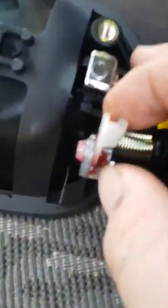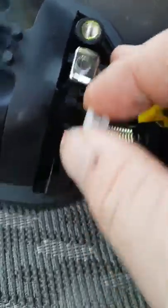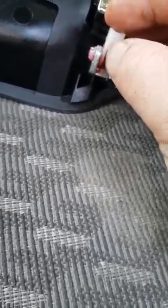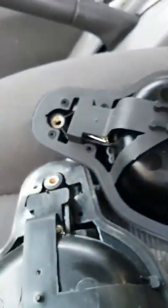Here's what I actually did - I took it out, put grease on it, and as I'm wriggling it back and forth I dropped some thin air tool oil on it as well. It still feels a bit tight but I'm sure that'll sort itself out eventually - it's certainly a lot better than what it was and it'll improve over time as my driver's door did. These are brand new parts. Get it in - bottom clips in then follow it up with the top clip and put the bolts in.